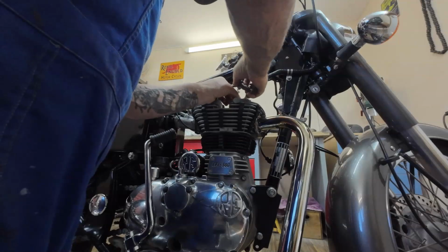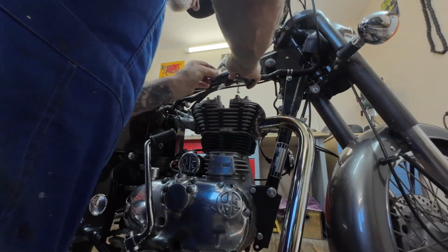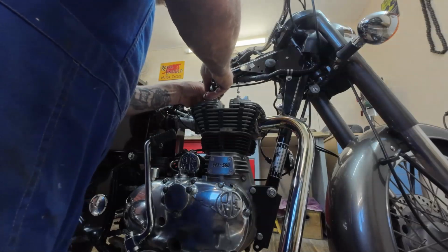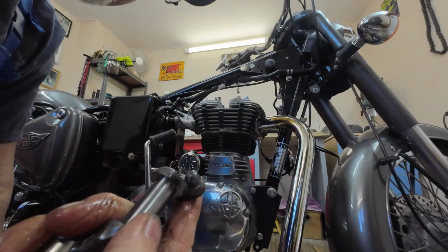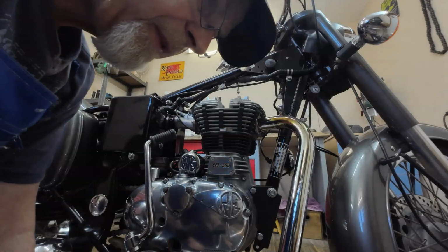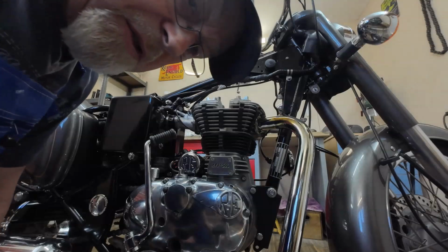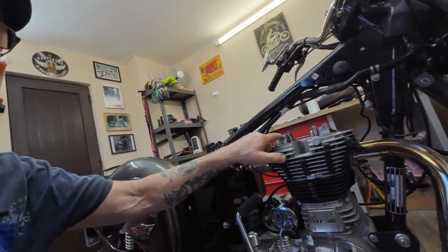What's the push rod look like? Yeah, where these sit in the push rod is really worn. This one drops right inside, where the exhaust one actually sticks. So I'm not sure which one is the worst, but they're both worn anyway. It looks like it wants a set of rocker arms in it. I don't know till they look. Now whether you can buy just rocker arms or you've got to buy the complete caps and everything, whatever it needs it's got to have, isn't it.